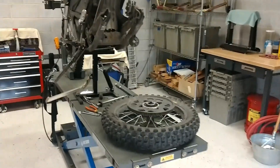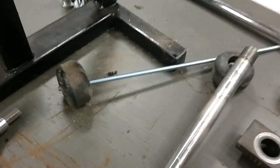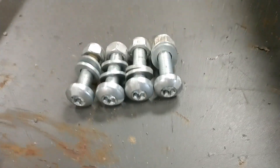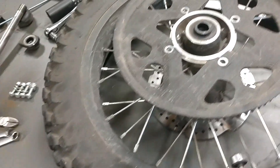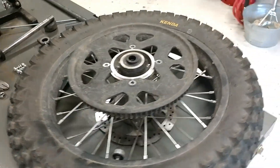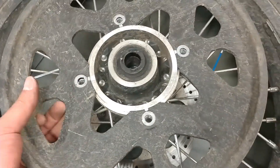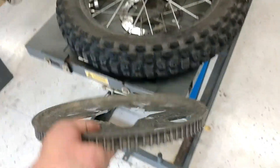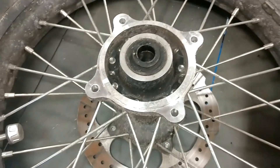I've made some progress: we've got the rear wheel off, pulled the axle out. That's the axle slider setup — just a piece of all-thread. That's the old hardware — it's a T45 Torx, I think. I haven't gotten the chain kit yet, but the instructions say it's supposed to be a 6mm hex. They were T45s on mine, so that might be a 2018 update, I'm not sure. This should just pull off. There's our old pulley, there's our mount where we're going to put the new one.